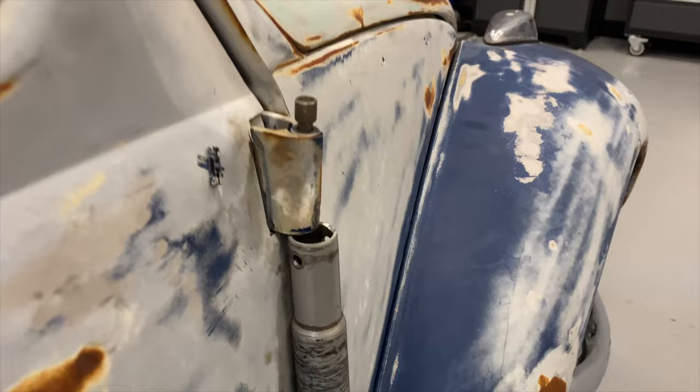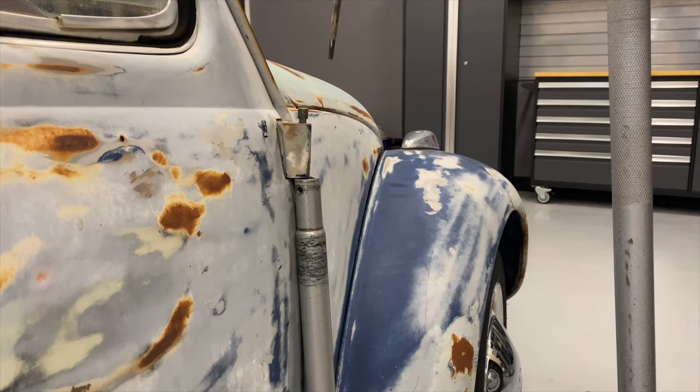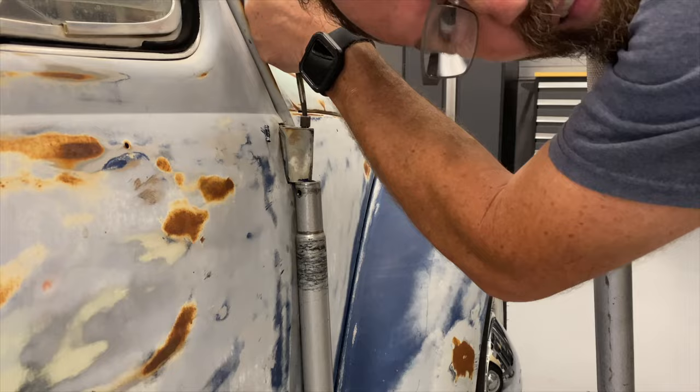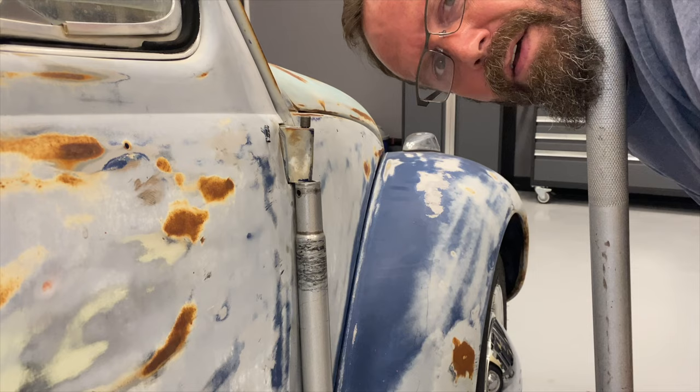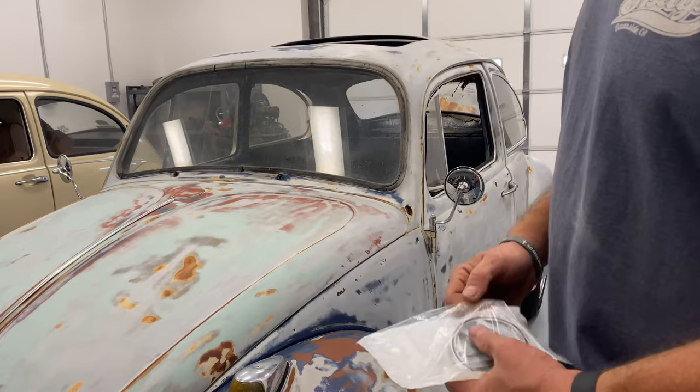So this is what I've resorted to: a jack, extra jack handle, bracing the hinge so I can drive that pin home that last little bit. I'm going to call that good. And now you can see why we don't recommend replacing these pins if your car has been painted. It is a ton of force to get that stupid little pin out — not to mention a ton of force to get it back in.